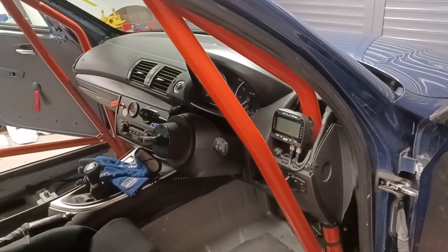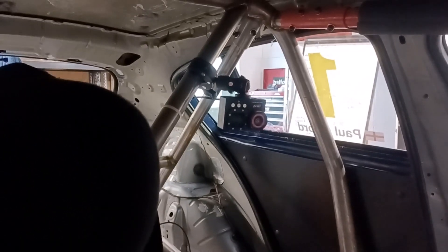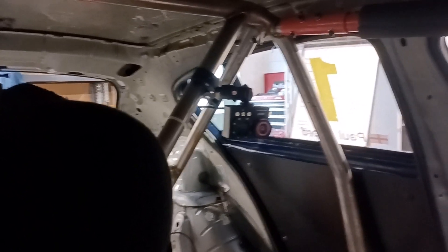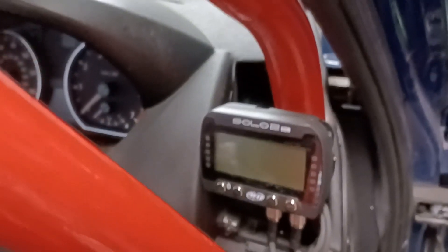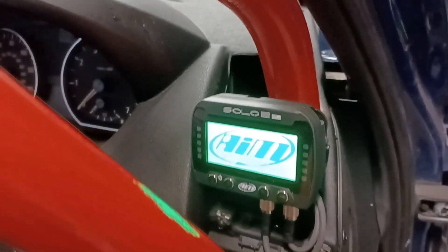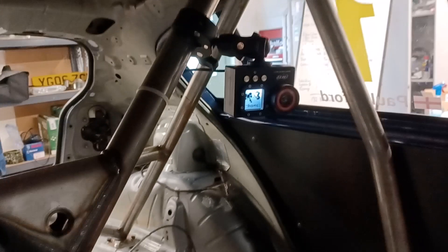The first thing is that my forward-facing camera is just there, and you'll perhaps recognise it as an AIM Smarticam. It's linked to my data logger, and if we put the power on in the car you'll see it comes on. The camera starts recording when the data logger starts recording, so whatever parameters you've got set for the data logger, the camera will record to keep the video file and the data file aligned.